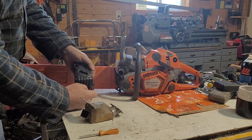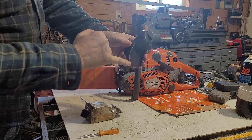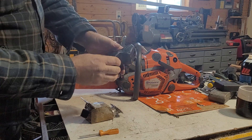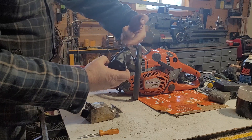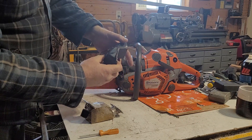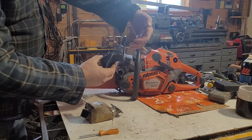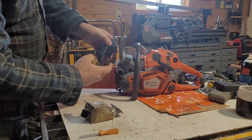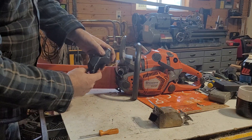It's also quite heavy. On my stock one, I cut a lot of this bulge out of the back here so that it would allow the exhaust gases to basically go straight through. The other theory I had was that opening this up would also allow a little bit more airflow underneath it and not heat soak the crankcase as much on that end.